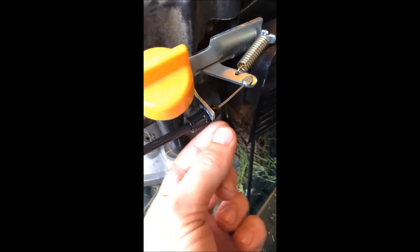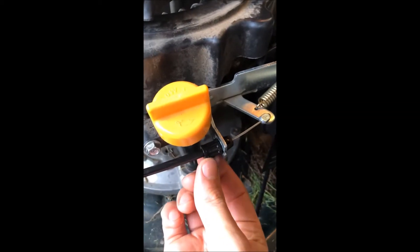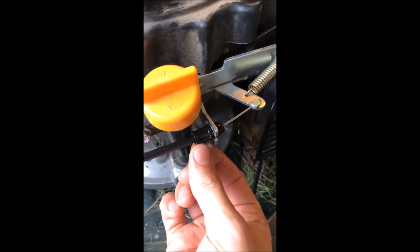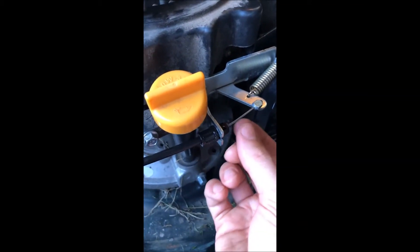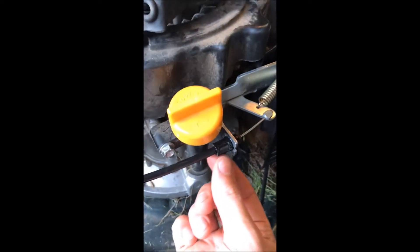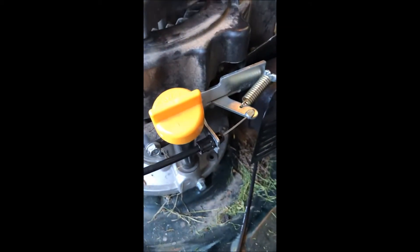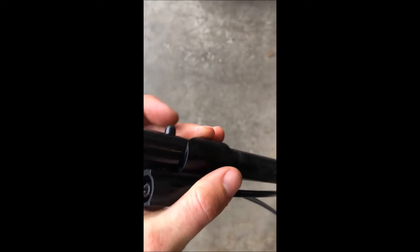What I had to do was basically pull the cable off. You can see right here — if you just depress those little tabs, you can pop that out. You'll see other videos talking about fixing the throttle cable; you can adjust this, and I'm actually going to adjust it a little bit more just to give myself a little more length in the cable for a little more pull. All you've got to do is turn them and you can get yourself an extra half inch on either end.